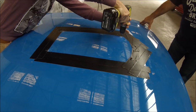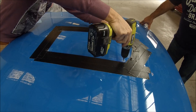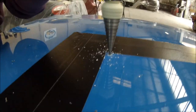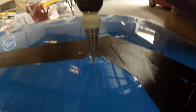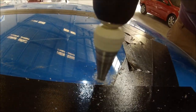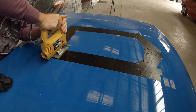The main reason to do it beforehand is that when you drill into the bonnet you're exposing bare metal which could then rust up, which we end up touching up. You also run the risk of possibly scratching your paint work, which if you're careful — by putting this big thick black tape over it — should be okay. And it turned out we didn't damage it. We drilled some pilot holes first with a smaller drill bit and then used a bigger bit to bore it out so we can fit our jigsaw into it.